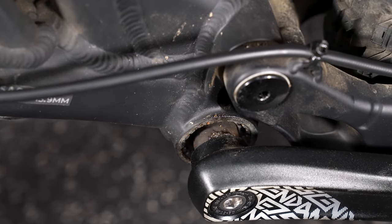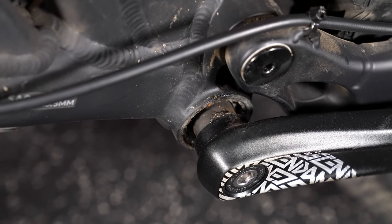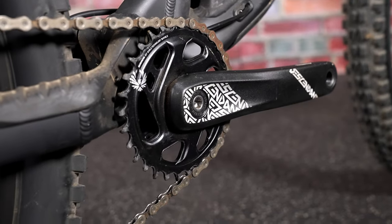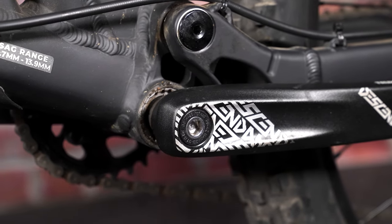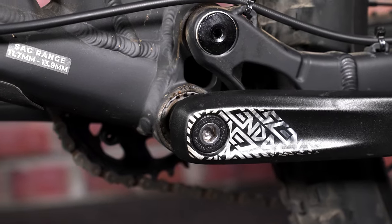So it's interesting to see the bike at this price point — I would have thought they could have gone a nicer spec there. It also has 175mm cranks. Would the cranks be tied into the bottom bracket, or could you upgrade the bottom bracket later? Eventually if you get a different bottom bracket, you have to get new cranks too, so your whole package is tied into that lower-end system — it's going to cost more in the future to upgrade. And 175mm cranks, a couple of years ago would have been very common, but we've largely moved to shorter cranks for more clearance. Even five millimeters shorter makes a difference — I was hitting my pedals on this bike where I don't usually, and I looked and saw 175s. It sounds really stupid, but it does make a difference.